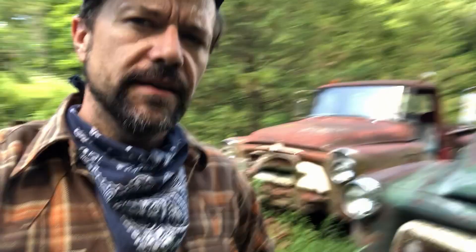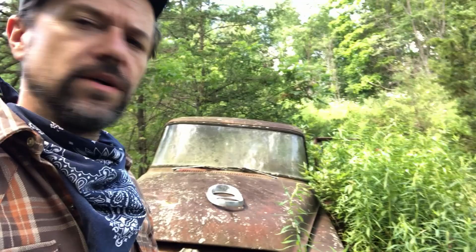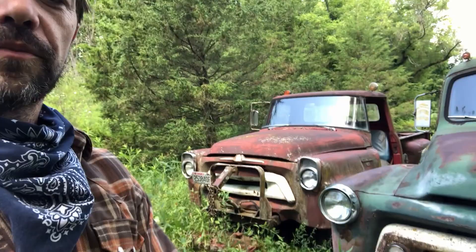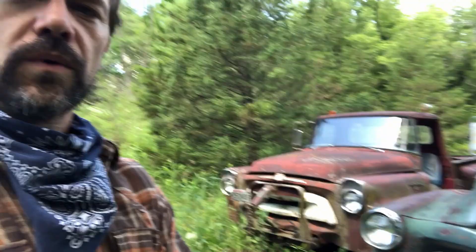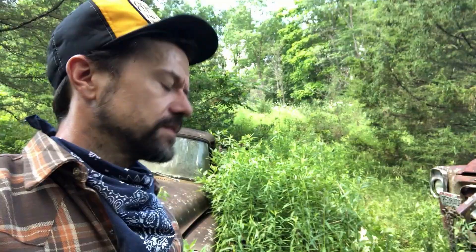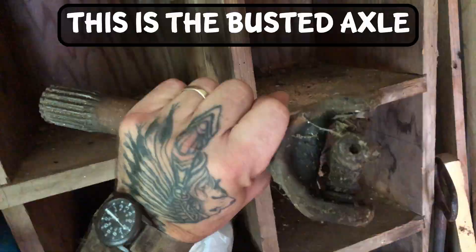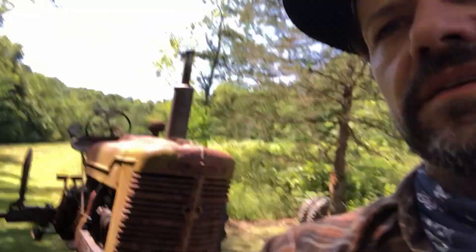Behind me here is the B100 that when I was a kid, my dad bought as a parts truck for the A120. He got the A120 before I was born because he needed a cheap four-wheel drive truck to haul wood. What eventually led to it not being used anymore — on these four-wheel drive Internationals they use Dana 44 closed-knuckle axles. The spindle bushing inside gets worn out, and the universal joint of the drive axle starts knocking on it and actually busted the axle. Once the four-wheel drive was knocked out of it, it wasn't too useful around here.